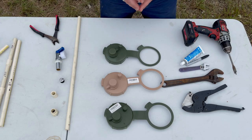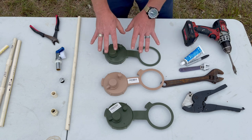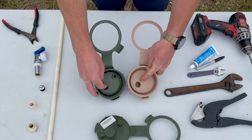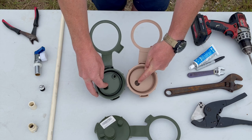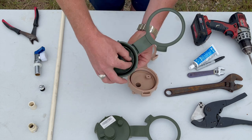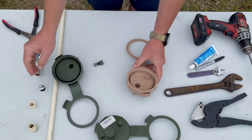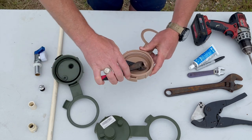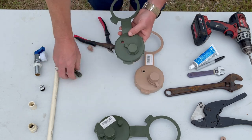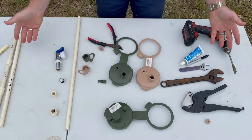We're just six simple steps away from customizing your own cap. Step one: remove the cap and vent. This is the actual Scepter brand cap and this is the off-brand. The off-brand cap has a slightly bigger ID hole in diameter and has a molded stopple on the bottom side, whereas the Scepter is just a quick pinch — push it and pull it out. The off-brand you'll need to take pliers and snip it off, then unscrew and pull off. Step one complete.